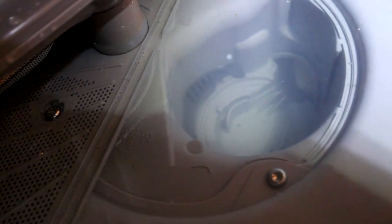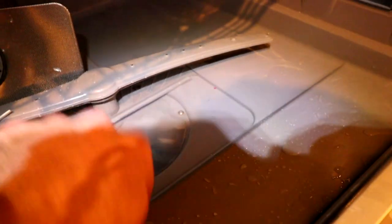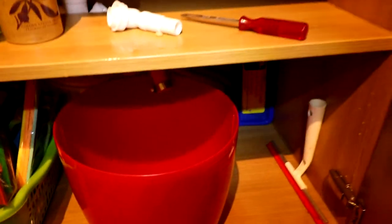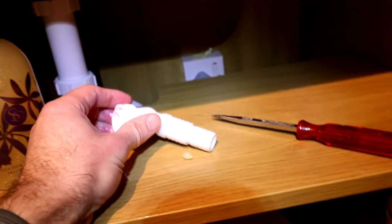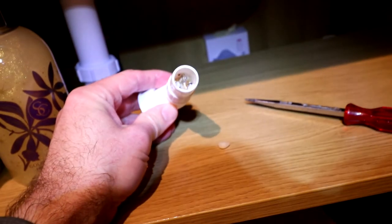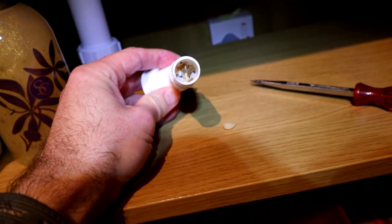So they've got past the impeller — bizarre, isn't it? Obviously it didn't mash them up. Just thought I'd do a quick film to show that you can get to the impeller down there by prising this piece out, and you can thread a piece of pipe — it kind of goes this way first and then down. I managed to get it almost to the end here but ran out of flex. It seemed to stop, so I got this end off and sure enough, after emptying a bit into a bucket, there's the blockage.